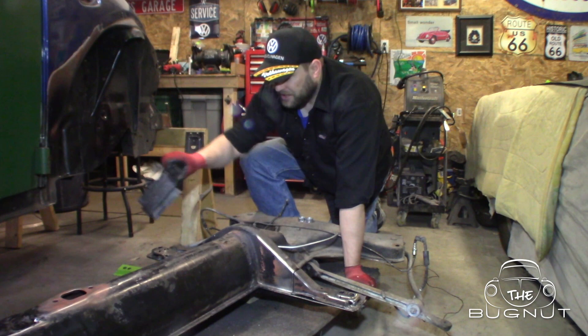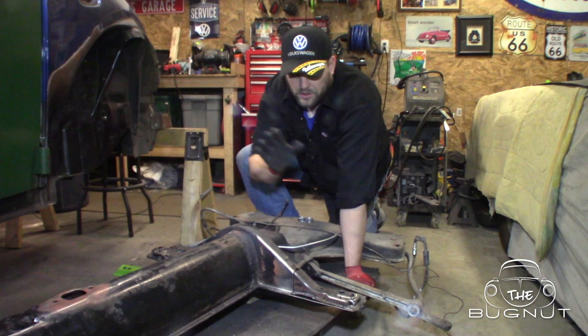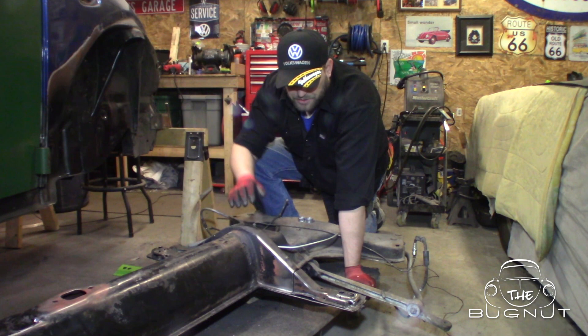Don't remove those pieces until you know they're ready to be thrown away. From here, we laid everything out onto a piece of 16 gauge sheet metal. This piece here is for the other side, and this one is for this side. This is in the middle of being completed — it will be the Napoleon hat end for the driver's side. I started on the passenger side first. I like to mark things off with tape and then use my angle grinder to cut through the metal, then use my air chisel to break all the welds.